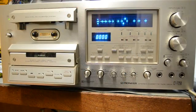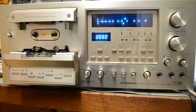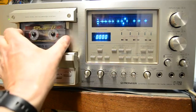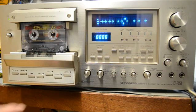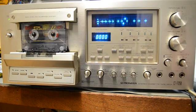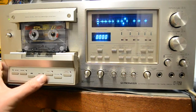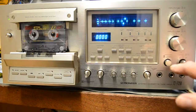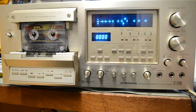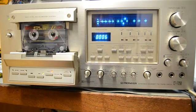Right, here we are — the Pioneer CT-F1250 cassette recorder. It's a Pop Art Deluxe, not a TDK D46. I'll point out there's actually nothing wrong with a TDK D46 — it's a perfectly average tape. Right, to calibrate it: the machine's got three heads, we can listen to stuff that was recorded moments before, so that's how we do the calibration. Monitor is currently on source. That tape is standard, Dolby off for the calibration procedure. Put it into record and wait until we're actually on the magnetic tape bit.